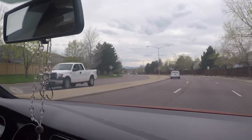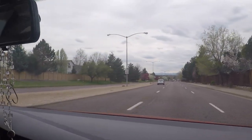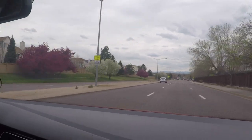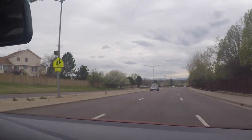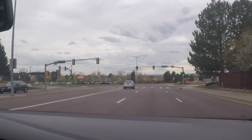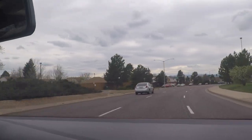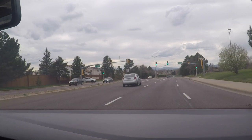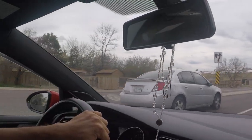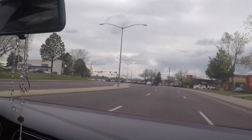Definitely something to keep in mind if you're thinking of getting an aftermarket clutch — the pedal is going to feel different. One more thing that really concerned me before I ordered this clutch was the chatter or noise. It was definitely there; it sounded kind of like a tractor. I knew there was going to be some sound but didn't know how loud. At first it was very noticeable, especially in drive-throughs or when the car was idling, but after about a thousand miles it kind of went away.